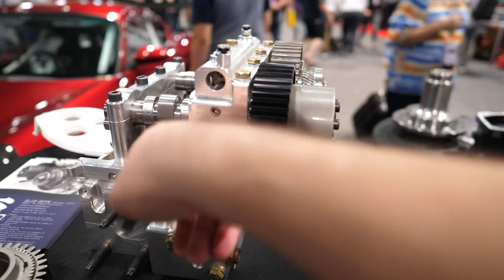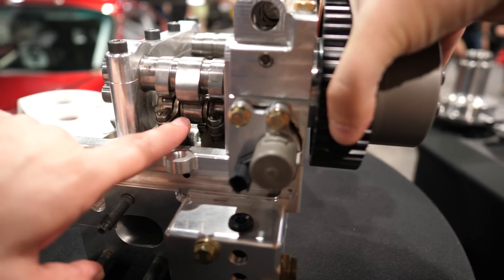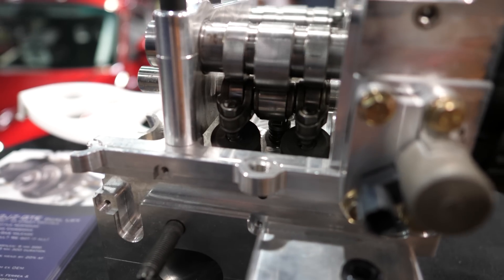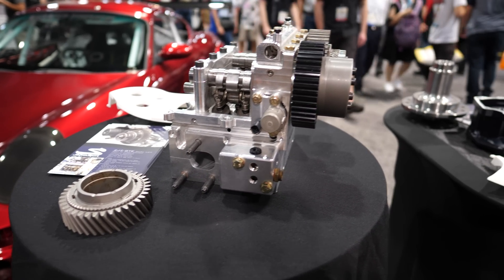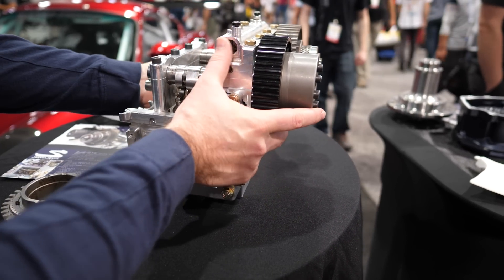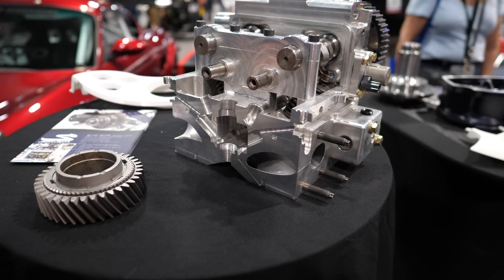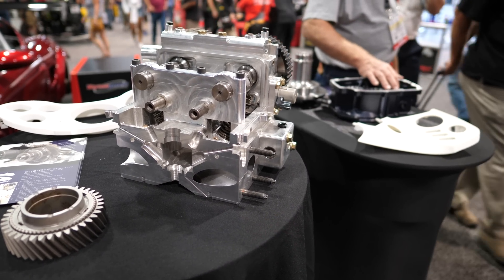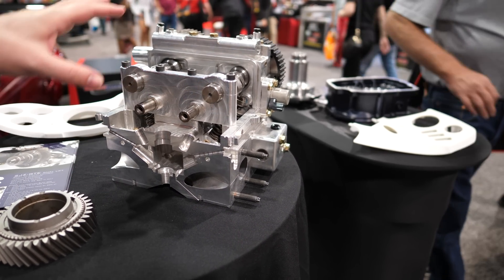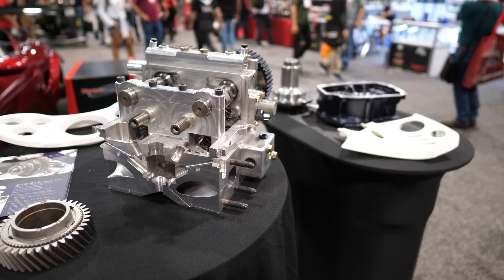So right now these will separate if I spin this? Yeah, but the spring is pretty stiff, but you can see. Yeah, I can see that it wants them. Is it going to be a two-piece design when it's fully in production? Yes. We need two-piece because otherwise you cannot get the water in — no room for a water jacket. We will make a one-piece, but it's a metal model only, and a one-piece will also not have the VTEC and the variable valve timing. It's drag racing only.